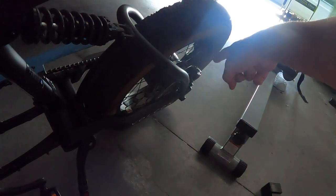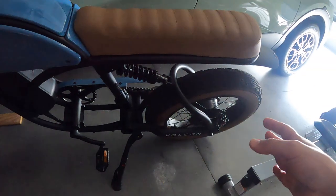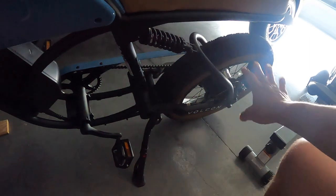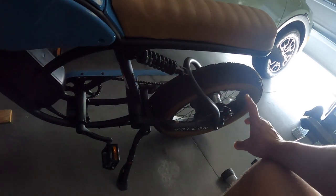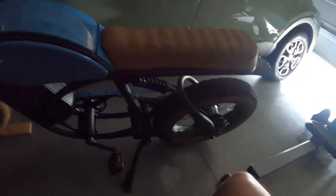The caliper wasn't aligned properly and the fitting was installed improperly — all this with less than 30 miles on the bike. I really like the bike, I think it's so cool, and I don't want to give them a hard time, but I just want to let everybody know. I found the rotors online on Amazon — they're 180mm, front and back. The brake pads are Shimano e-bike brake pads, I believe B05S. I'll put the part links in the description below.